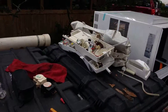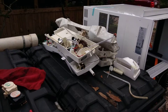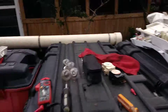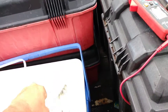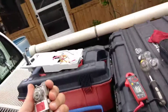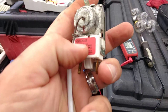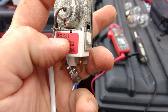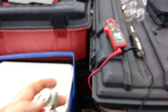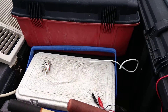Figured I'd share that with you. It's an interesting statistic that four out of five refrigerators had a bad thermostat. So before you toss your refrigerator, you might just want to check the thermostat and make sure it's working. They're real easy to order as replacements online — just type in one of these two numbers, probably that top number, and you can get your replacement thermostat and save yourself from buying another fridge.